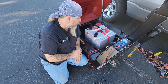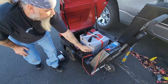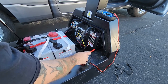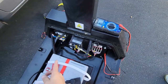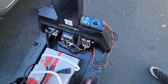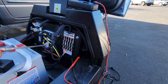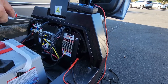If you look at the fuses, each one tells you its rating — especially when brand new: 2 amp, 5 amp, 2 amp, 2 amp, 2 amp. Over there is your big dog where the main battery power comes in — the 80 amp distributes all the power to all the components. This right here is your controller, same concept as with the Amigos. If you need to test wires and where they're going, just follow your color code.